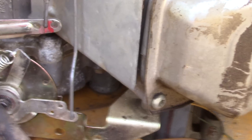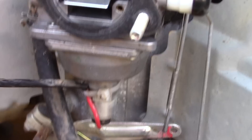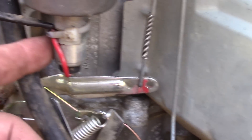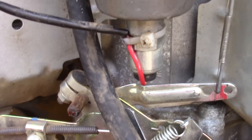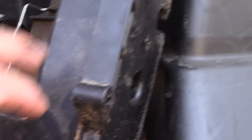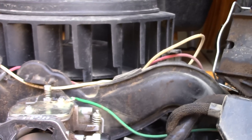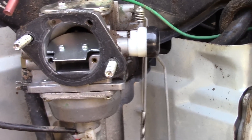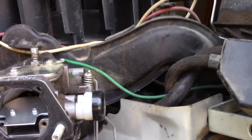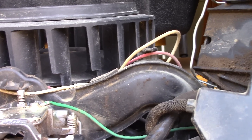He said he took some of this apart - oh my God. We are going to go ahead and pull it apart. I have the fuel solenoid right there disconnected and slid off. This cover box was held on by two 10mm bolts, right there. We are keeping up with all our old stuff - they were 10mm, came off really easy once I figured out what size they were. Now I am going to pull this guy off and start cleaning the carburetor and draining fuel.